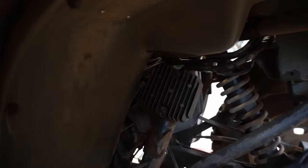All right, so I just got the new CDI. This one's the old one I just took off. And I just plugged in the new one down here, right there, you can see. Vinny, gonna help me out? Let's see if we've got spark now. And then what we're gonna do, if we do have spark, is start it up. And then we'll see if that voltage regulator's working.